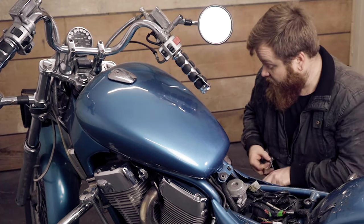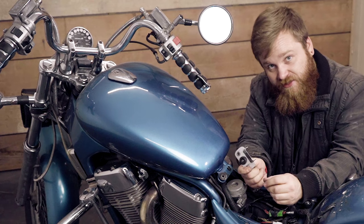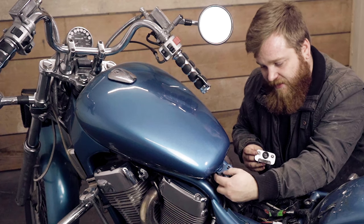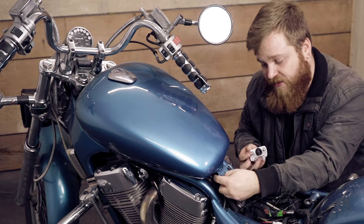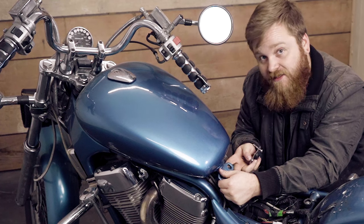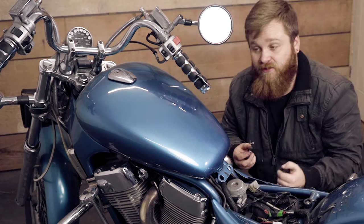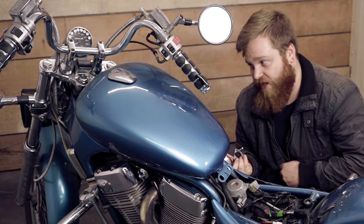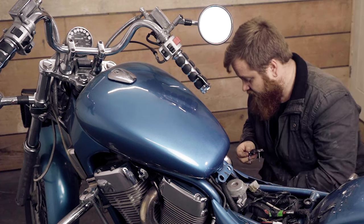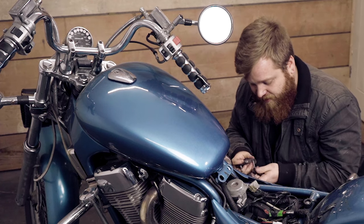What I mean by this is: this mounting bracket here, we know it's going to have to go back on and we're going to be using the same tank. So I like to put my bolts back into the bracket itself. If you can get the mounting bushings out, just be very careful at this point because there is nothing holding the tank in place at the moment. Take your time. If you've got a friend, they can stand on the other side and support the tank. I like to put the bolts back in here so everything is in one location and is safe.